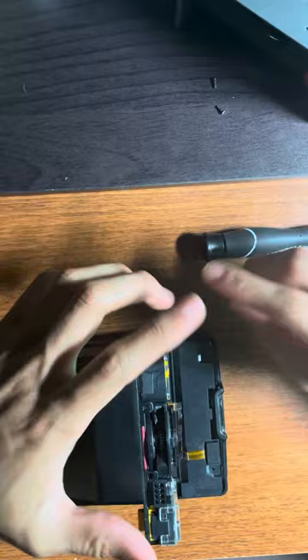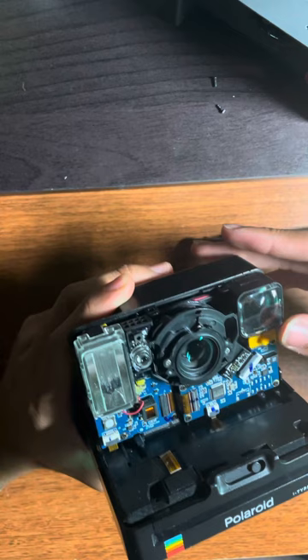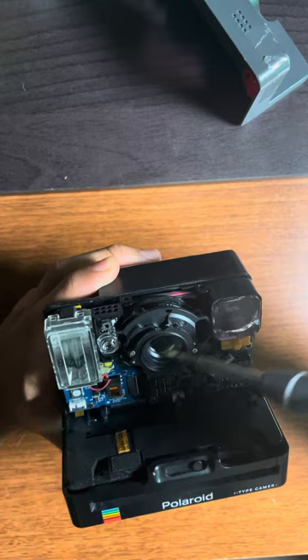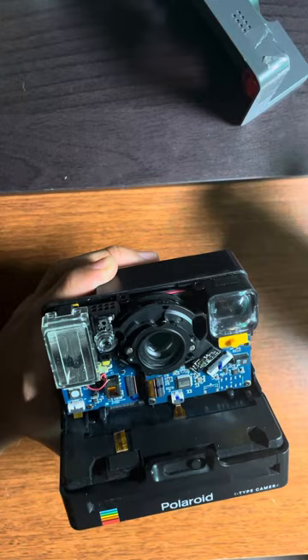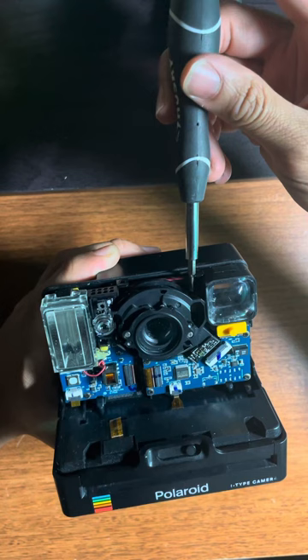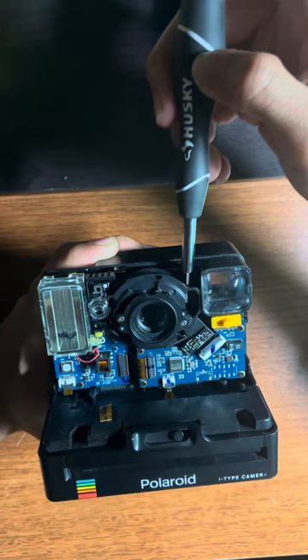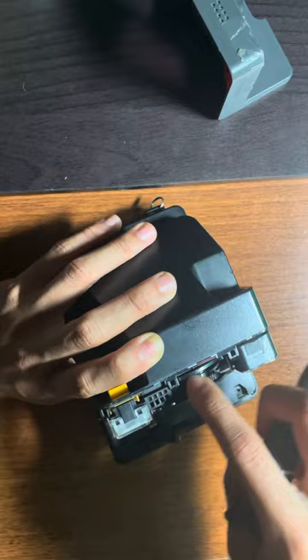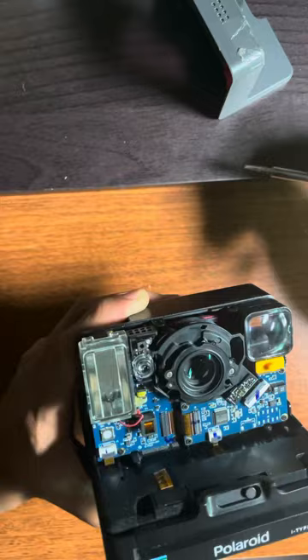Here's the inner part of the camera. Not really too much you have to touch or fiddle with here. This center part is kind of the main attraction. You can't really see my repair, but I used a black rubber pin back — the kind you'd use for lapel pins. The idea is you want to insert something into this cavity, especially down towards the left, so that this piece is jammed. You'll know it's not working if you can touch this part and it's moving. Mine is stuck because something is jammed in there, and that's good — because what's jammed is the lens side.